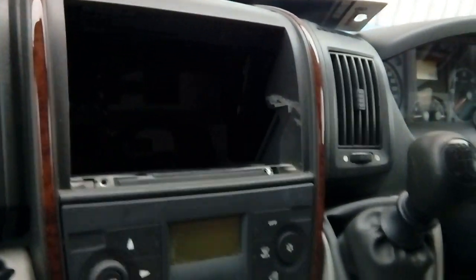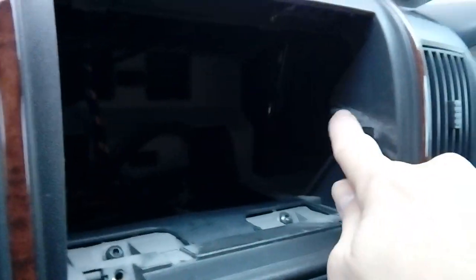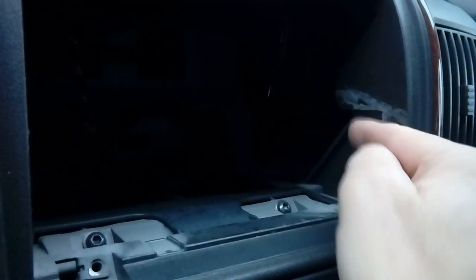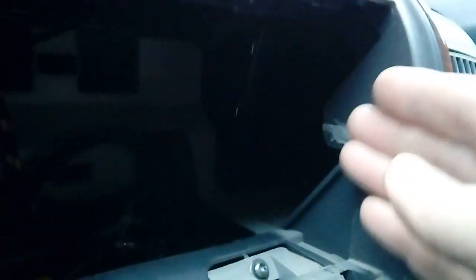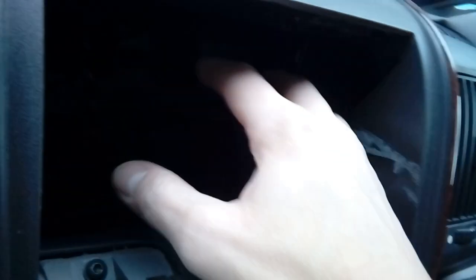This one looks like it's been out a lot — it's completely loose and not even wired in. Someone may have just shoved a radio in the hole. Now, this one has already had the modification done. There's a piece of plastic on both sides that sticks out — some have a bar all the way across depending on the year. What you have to do is hacksaw it off on both sides so it's smooth. Take your time, don't scratch the front of the dashboard. Put a rag underneath to catch the bits as you saw them off and make a nice neat job.